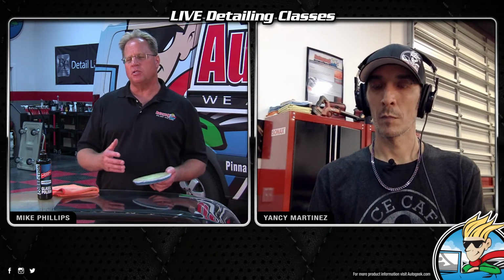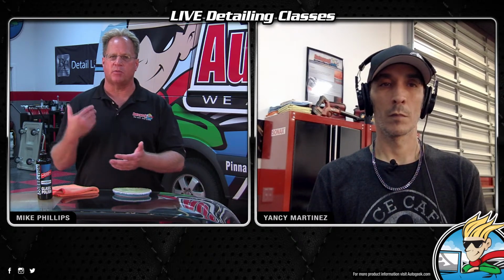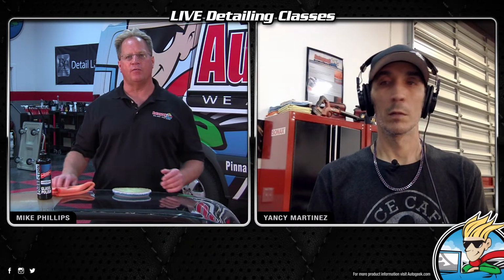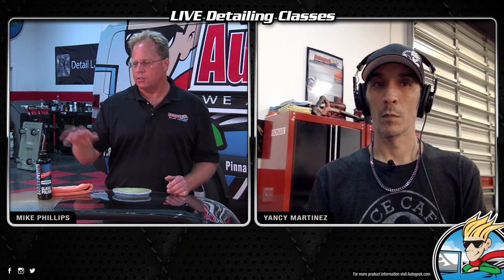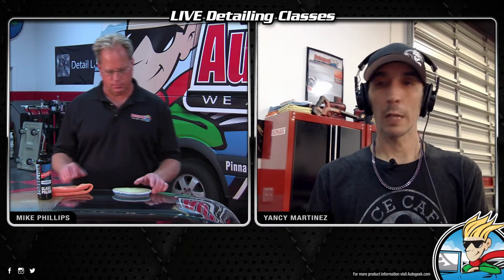But there's no reason to use a soft foam finishing pad to buff out really bad glass. It just doesn't even make sense. You want something that's going to trap that abrasive between the pad and the glass and grind it into the glass to pull this really horrible film off. So don't get caught up on the pad. Whatever cutting pad you've got, just remember to dedicate it to that polish. Do not mix it the next time you're buffing out a car with your paint care compounds, polishes, or cleaner waxes. Like with like, people.